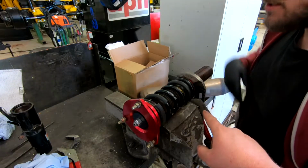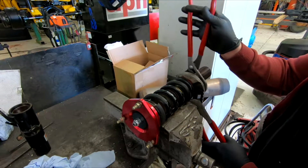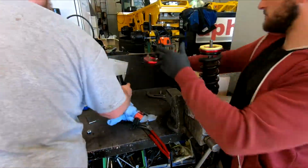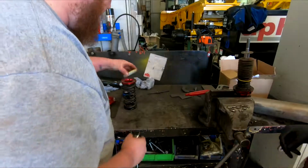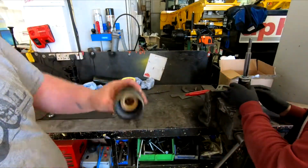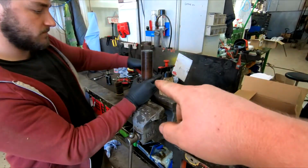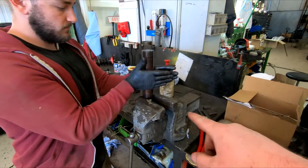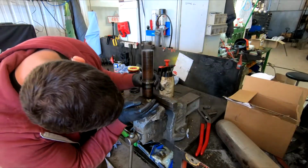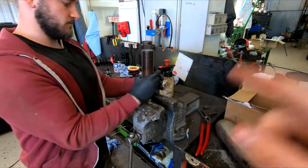These are not BC approved, but I left the spanners to do this at home, so Stavros is improvising. This is not the ideal way. We're mixing it up, we're throwing different angles and situations. Well, actually, to be honest, we got this free, just clean each side and then a little bit of WD-40 and then just gently guide it with these pipe grips. We're going to strip this off here while we're, like you just saw, and then we're going to time lapse reassembly and copper grease. Copper grease is the most important bit because it is what stops them from seizing.